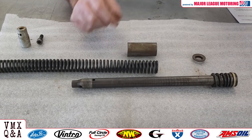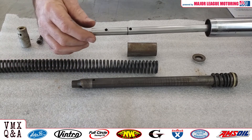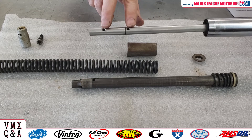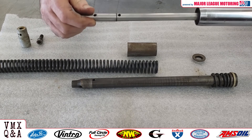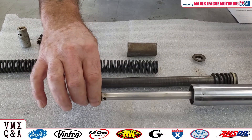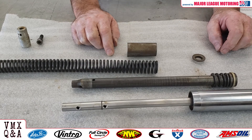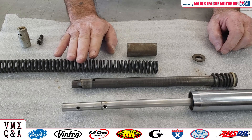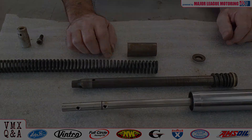Here's another damper rod — this one happens to be a Yamaha, the other one is a Honda. This one has two holes that are a little bit further apart than the one on the Honda rod. You can look for those differences and look for fork kits — your bike might have a fork kit on it, so be aware of that before you change anything. Keep in mind the viscosity of the oil, the spring and how it's wound, what it's suited for as far as your weight, and of course the oil as well.